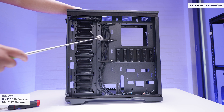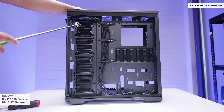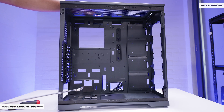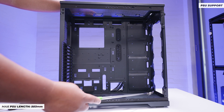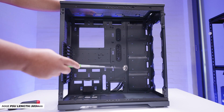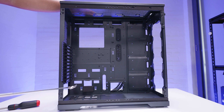For storage there are 11 2.5-inch SSD locations — you can see three here, and you can mount them to the other side with assorted mounting points all through the case. Power supply support is basically unlimited with no restriction on the size. You do need to keep in mind that if you're installing drives all the way up the front, you'll reduce that space. Not only that, it will support dual redundant power supplies in a regular ATX form factor, which means if you're using this with a server motherboard that has dual power inputs or need extra power for a use case, you can run dual redundant PSUs.